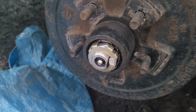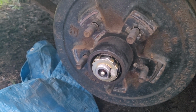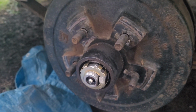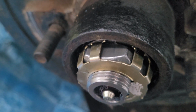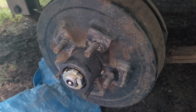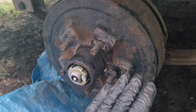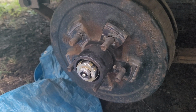Now, what you saw in the video, it's getting towards the minimum of the brakes. I don't have brakes here, but they will pass as I saw them. I didn't measure them, but I'm well familiar with what they check and how they check. So I'll be confident in my abilities to look at that and say that that is a passable brake pad. Not going to get much more life out of them. I'm probably going to have to change them midway through the season, but anyway, let me get the dust cover on, and we'll go on the backside, and I'll show you how to adjust.